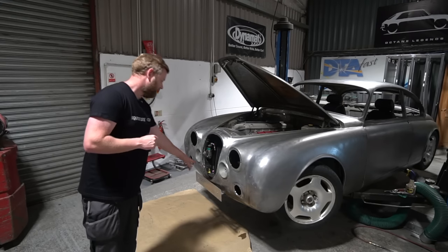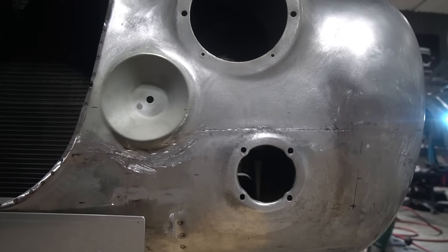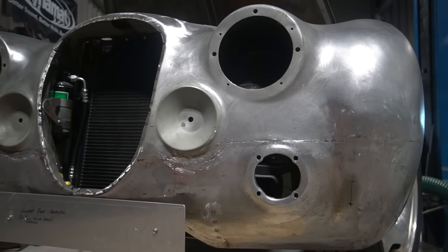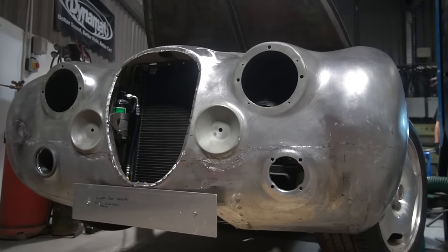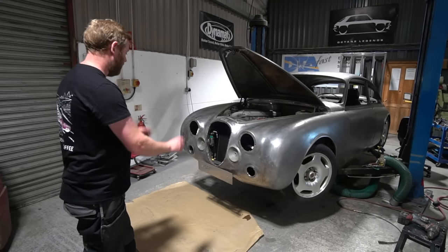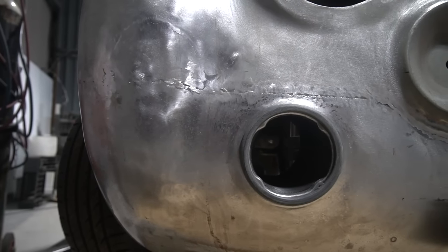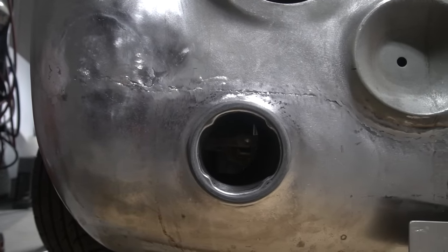We've done the shaping work on the front end for where these air intakes are. So I think I mentioned last week we'd modelled them, we're gonna do a 3D print so we could use that to shape the bodywork at the front there. And then Stu's made a nice little simple press tool or hammer form tool to basically allow him to hammer around that flange there to give it a bit of stiffness, created the flat plinth. They sit nicely on there, and then these will eventually be a machined brass part that's copper plated with a mesh inside it. So that's looking good.